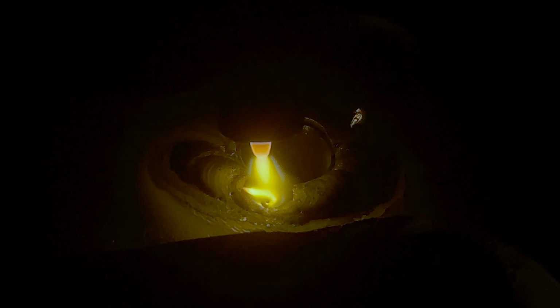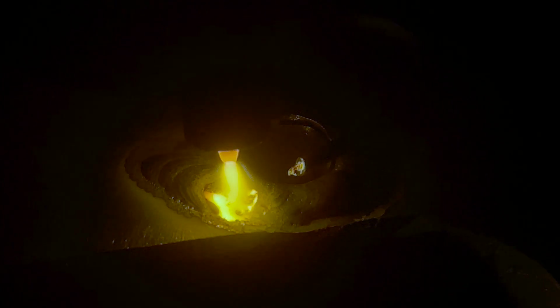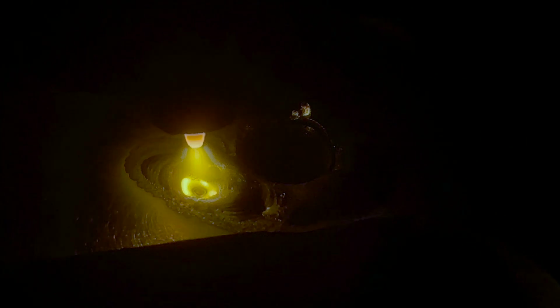on occasion you'll see the black dust come up, or you might even see a spot of porosity come up on the back side of my arc because I've taken away the gas coverage, and that's because of my torch angle. But I'm trying to keep the arc away from that stainless cup. See that? We just pulled up a little porosity.